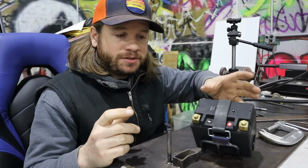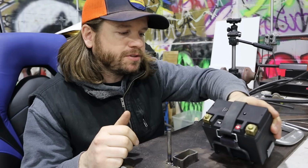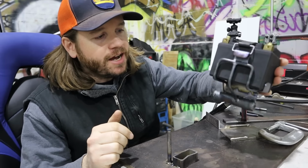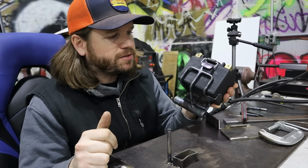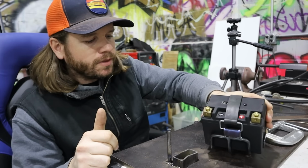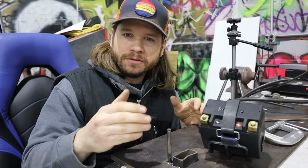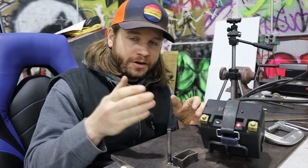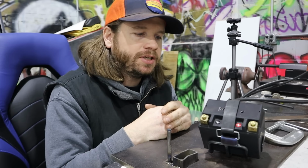So yes, in short, I could have built maybe a big sheet metal enclosure or something like that, but for me, I just don't feel like it's necessary. I've been having fun lately working with more bent rod and stuff like that. It's more fun for me to make. And yeah, I like utilizing the area under the bike. So if we do choose to add some protection, I might be able to put a little mini inner fender or some kind of debris shield in front, in between the tire and the battery itself, just to help keep it a little bit more clean.